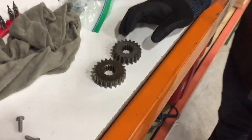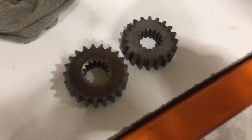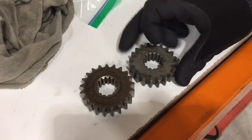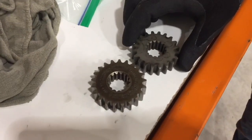So if you look at all the gear down, all the belt drives, they're all doing gear downs. I think everything except for maybe the Polaris, the new belt drive they just came out with, the QD2 or Q something 2. But most guys are gearing down so they have that lower end power. So here's the two gears, 21 down to 20, just like riding a bike. Yeah. Smaller gear, more torque.